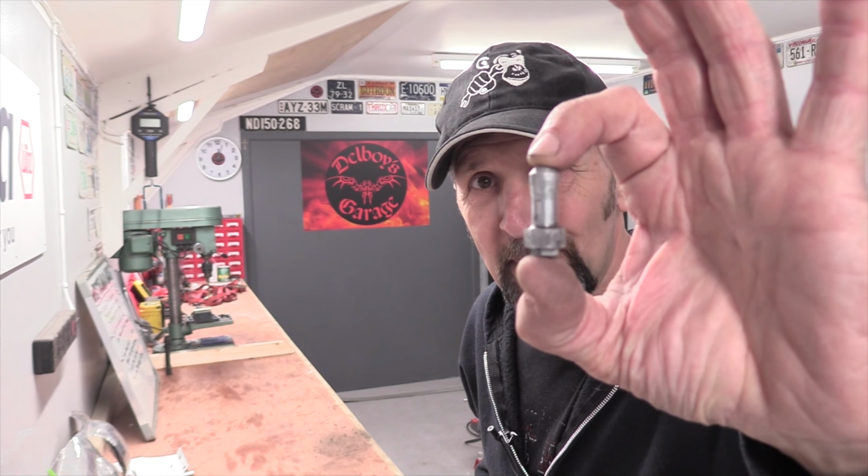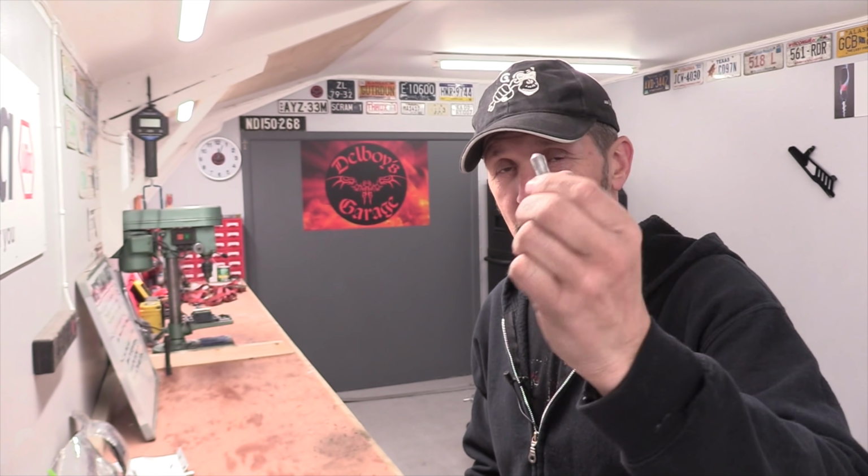This is the seat securing pin for a Harley Davidson V-Rod, and it's snapped off with the bolt inside it, which is a common problem because the bolts are mild steel and the pin itself is aluminium, and the two corrode together. That's got a hex on it to remove it. That's a nice big spanner. Put it on, turn it, snap.